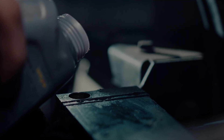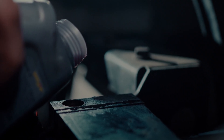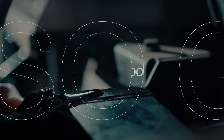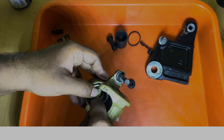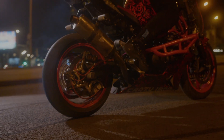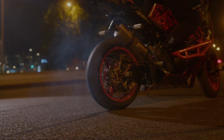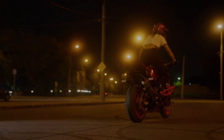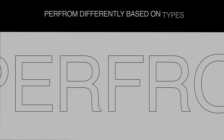But that is not the only job brake fluid does. Brake fluid, in order to be compatible with all ABS modules, has to be less viscous or less thick in simple terms. But being too lean is also not good, as brake fluid must also lubricate all the oil seals inside your master cylinder and calipers. Apart from this, brake fluid must have a high boiling point to avoid vaporizing under heavy pressure when you apply brakes. Your brake fluid must also be corrosion resistant to keep the master cylinder, brake lines, and the entire braking system functioning smoothly for a longer time.